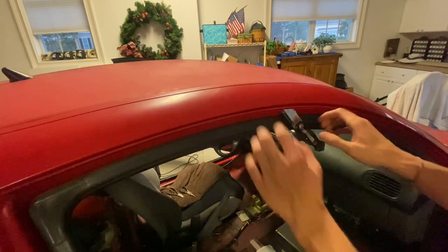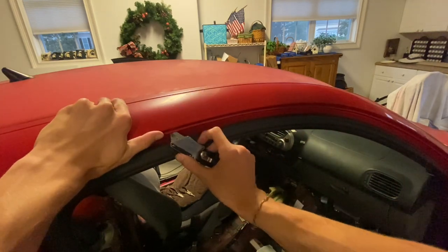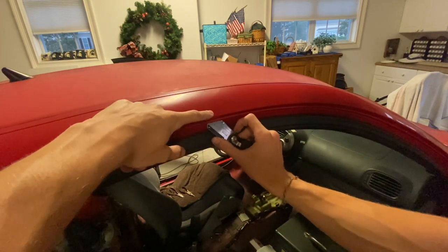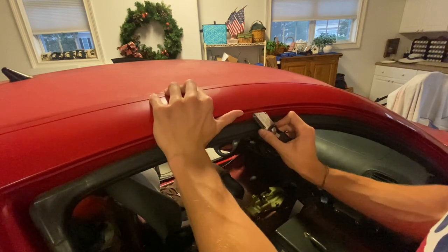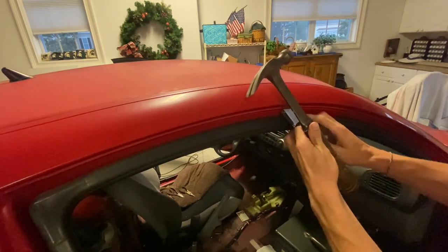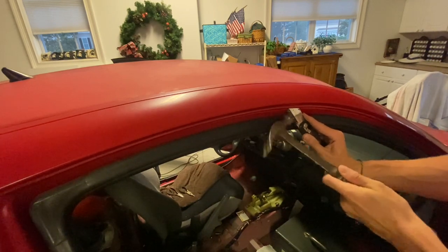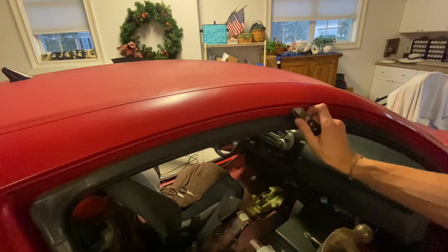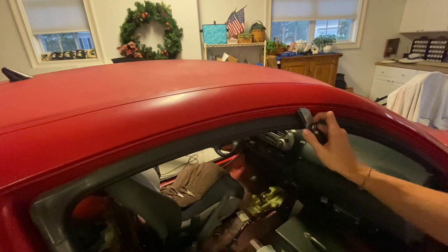The first step to removing this is you're gonna have to cut the eight plastic clips. Use a razor blade — something sharp — and you'll peel this up just slightly and run it along here. You should run into a clip right here which will stop you. Just keep sliding it forward, lift this up if you need to, keep going forward. Now you're gonna grab your hammer, hold your blade in place — I'd recommend a rubber mallet but I don't have one. And I think I got that clip — just gonna keep moving on down the pillar.